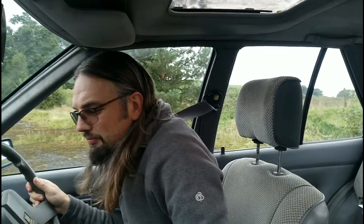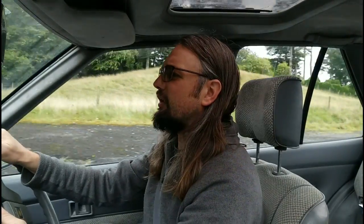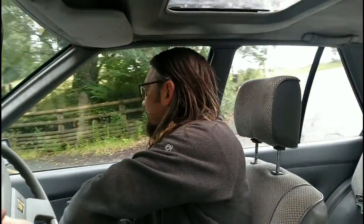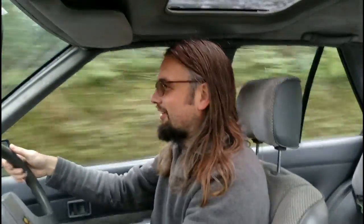Let's go and do some driving - we're up to five minutes already. Into the car, make sure you're definitely secure and we'll go for a drive. It fires nice and promptly into life. It's an automatic choke and that seems to work pretty well, though the revs don't always drop back down to tickover all that readily. Oh yeah, definitely something a bit rattly on the front. I think one of the inner strut rod ends is a bit loose - it was a verbal advisory on the MOT. I'm going to do something about that quite urgently.